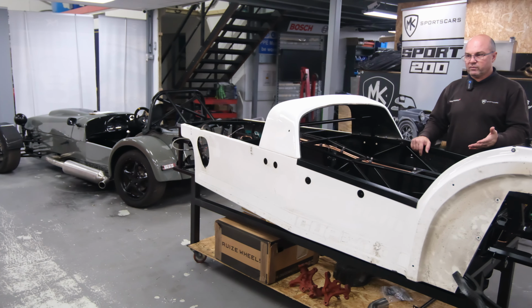And then Joe's just sitting about, we thought we'd check some of the issues that can be had with these, which was the valves and checking valve clearances. We found the valve clearances weren't the best. Joseph found that. Everything else, pistons and bores and that, it's honing good marks on it. We wouldn't normally strip right into these engines, but the process wasn't going to be that if we found no issues. Compression was good, but then we checked the valve clearances.